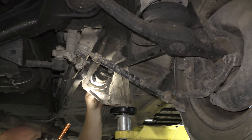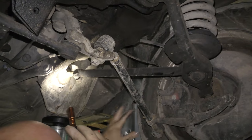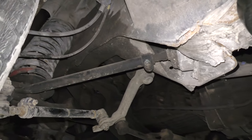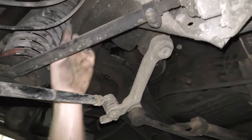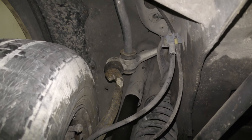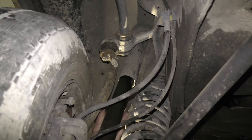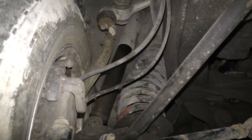These are the radius rods — amazingly they're in good, decent shape. Up here you can see it has one single little control arm, and that ball joint's in good shape. The bottom one is the one that's clunking. There are rubber bushings that go to a sway bar, and the control arm bushings are frequently bad, but on this one they're actually decent. The shocks have an oil coating all the way down them — it's going to need new shocks, but that doesn't surprise me on the front end.